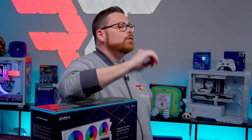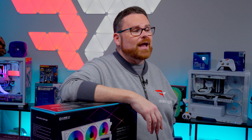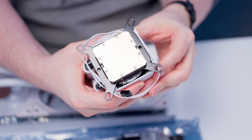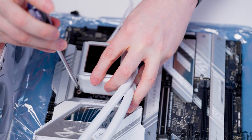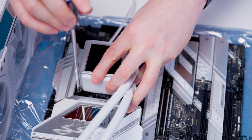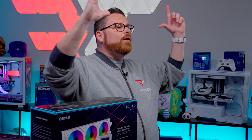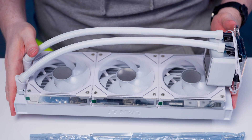Here's something that we absolutely love. Because this is an 8th gen Asetek AIO, they have drastically improved the installation experience for AMD users. Rather than using the bracket clips AMD motherboards ship with, the GA2 LCD has replacement extensions that match the holes on the motherboard. Basically, when you add four screws and do the bracket swap, the AMD motherboard bracket matches the hardware on the pump head — so it's like an Intel install at that point. No more wondering how many Intel or AMD brackets you'll have laying around. It's basically one bracket for all. And the GA2 LCD comes with its fans pre-installed on the radiator.